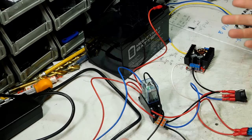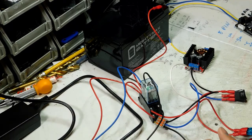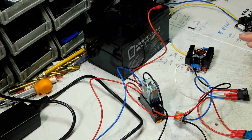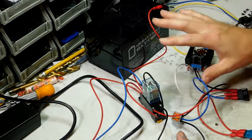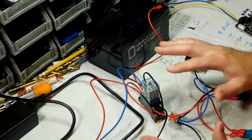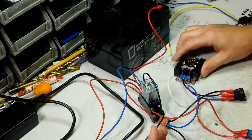Because of this, you're going to have to have two ports on your box — one port for your battery charger to plug in and one port for your power supply to plug in. Now let me show you how to hook up the relay, because that was one of the questions we had. Also, if you're going to do this, both your power supply and your battery have to be the same voltage. If you want to use a 24 volt battery that will work fine, but you're going to need a 24 volt power supply as well. Most relays are 12 volts, so you really need a 12 volt system — and that's where the voltage booster comes into play.